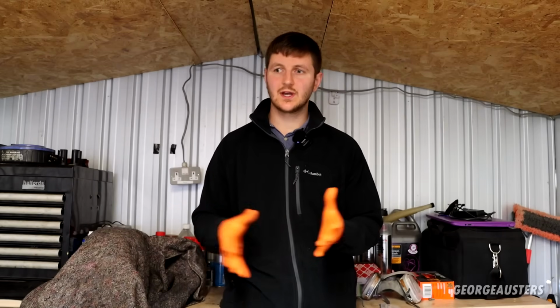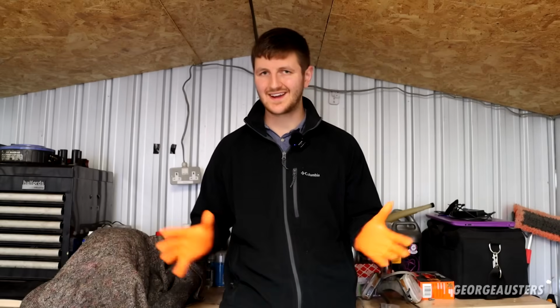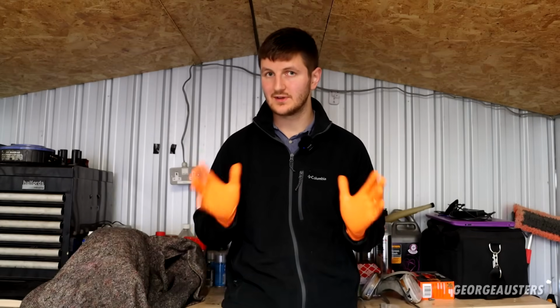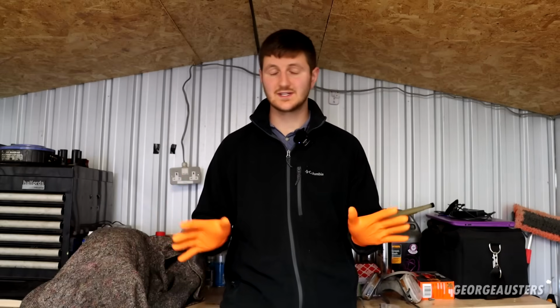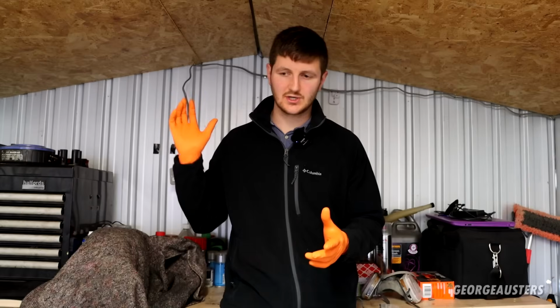And for those wondering, do you have to get it mapped out? Yes, you do, along with an EGR delete if you are removing the EGR as well. Now, another common question: can you pass an MOT with a DPF removed? Technically, no. You're not supposed to pass an MOT or an inspection with the DPF removed. But if you have a healthy engine, you don't have any issues, you're not burning oil or anything like that, there's no reason why you shouldn't pass. I've passed loads of MOTs absolutely fine with the DPF removed. It comes down to having a healthy engine, not burning oil, and not having an absolutely clogged intake manifold. We've replaced the intake manifold and cleaned out the intake ports, so we shouldn't be causing any smoke. I do just need to take it for a test drive to make sure everything is okay, but I don't see why not.